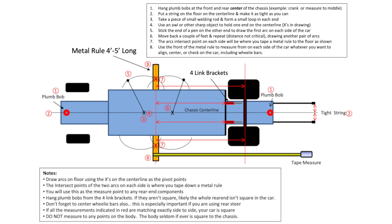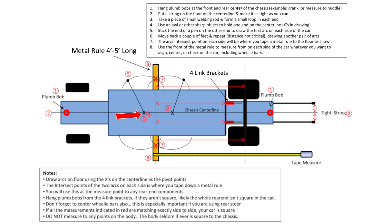Next, take a small piece of welding rod or some type of stiff rod that's not going to bend or flex easily. Form two loops on each end of the rod. The idea is to start at the center line of the car towards the front side — that's numbers three and four on the drawing. Use a sewing awl or screwdriver to position the rod onto the string, then make an arc on both sides of the vehicle — that's like number five in the drawing. Make an arc on the right side, then while the arc rod is secured to the center line of the string, swing around and make an arc on the other side of the car. Now you'll have an arc on each side.